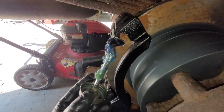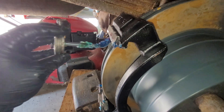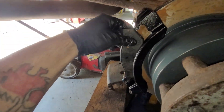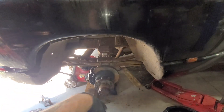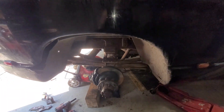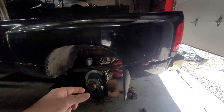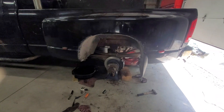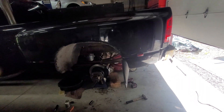I'm going to get this seal surface cleaned up, clean it all up, bolt the new rotor to it, throw it in. Imagine not using caliper grease — no professional puts brakes on without caliper grease. This is such a controversial thing on the channel, but you can tell who's not a mechanic because they'll tell you not to use it. If you want your brakes to last a long time, you gotta use caliper grease. One side done — I'm going to do the other side too. Sprayed it with brake clean. Brakes are done both sides. We'll get it bled a little later.